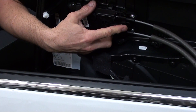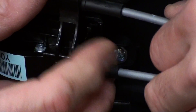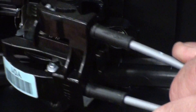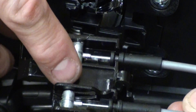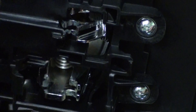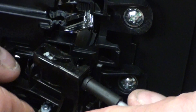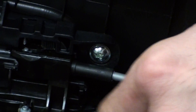Now we've got to release that mechanism back there. There's a little release right here — you just put it this way and it comes right out. It's reversed to put it back in. If you look at this little cable on this side, there's an actual spot right here where it goes in and those have to line up. The door lock one has to line up. The bottom one doesn't really move because the handle is sitting at a certain position, so that one goes right in. But the top one — you have to make sure that the lock is in a certain spot, then it'll clip in, or else it won't clip in. Just make sure of that when you're putting it back together.